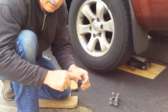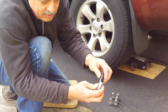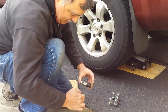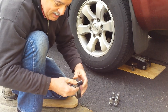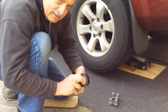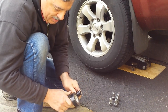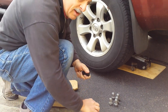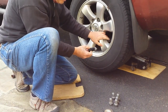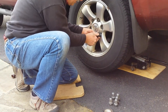If you recall, the washers are taped on here. This socket fits exactly over this part, so it's only making contact with the shoulder of the lug nut. Now I'm going to tape this on this lug nut — this will be my fulcrum for the lever I'm going to use to remove the wheel. It helps to tape everything together so you don't have to hold it by hand. Now I find a nice area where I can access this hole right here, and I'm going to put this on this lug nut about three or four turns.